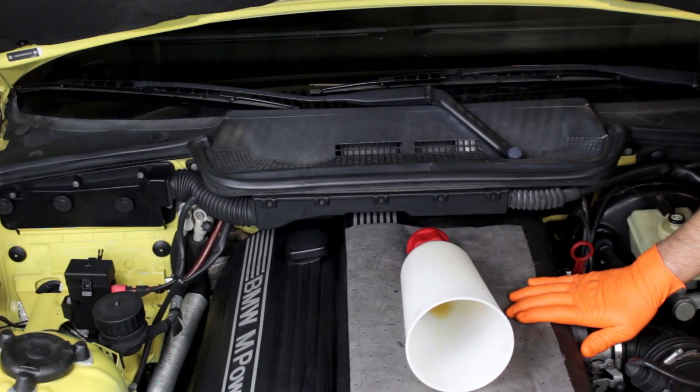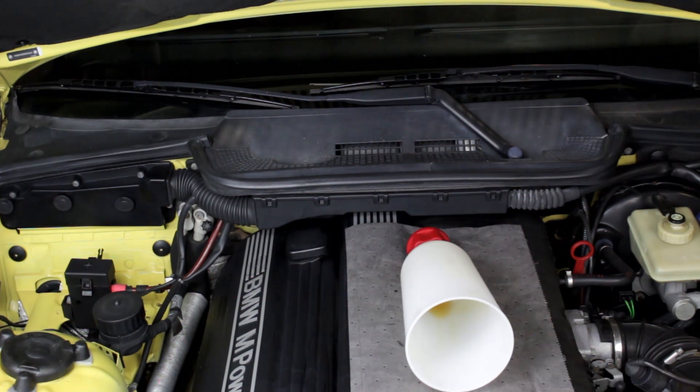After running the engine for a couple minutes, shut it off, wait a couple more minutes, and verify the final oil fill level. We did a full oil and filter change in about 15 minutes without getting under the car and without getting dirty — all we had to do is warm the engine up before we started. Remember that everything you've seen here is available in our online store at bavauto.com or give our advisors a call at 800-535-2002. If you've liked this video, please hit your like button and subscribe to our YouTube channel. You can also like us on Facebook and follow us on Instagram and Twitter. Thanks for watching and we're off to produce another DIY video.